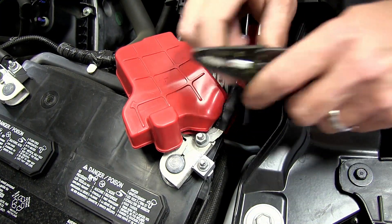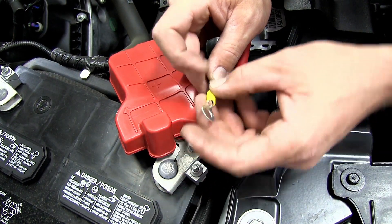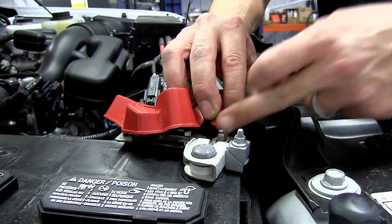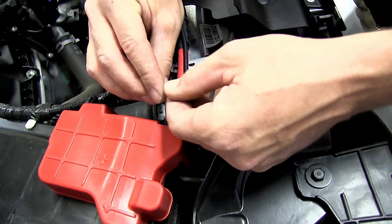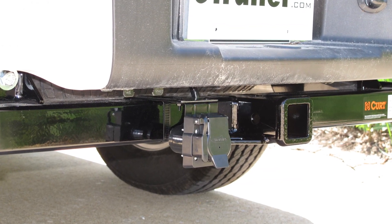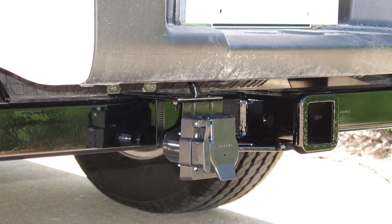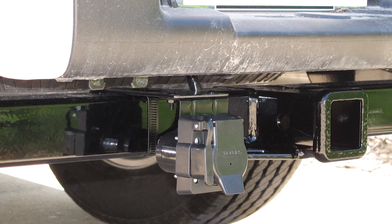Now that we've got our wire routed over to the battery, we'll go ahead and strip it back and add the battery ring terminal to the positive battery terminal. I'll just go ahead and take another zip tie to finish securing my wire and use my side cutters to cut off any excess from the zip ties, cleaning up our install look. With this completed, that will complete the install of our Hopkins 4-7 pole connector part number 37185, along with the tow-ready universal mounting bracket part number 18136, and our wiring install kit by Draw-Tight part number 5506 on our 2011 Ford F-150.